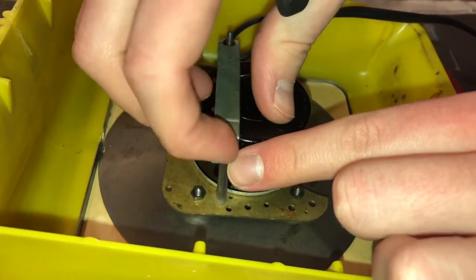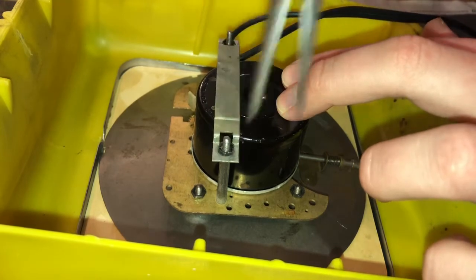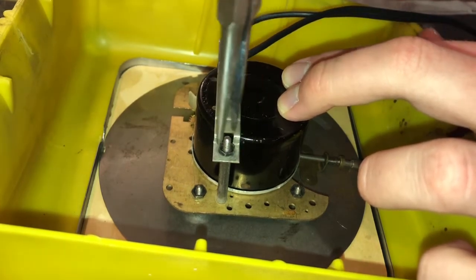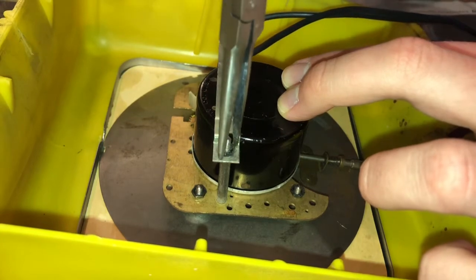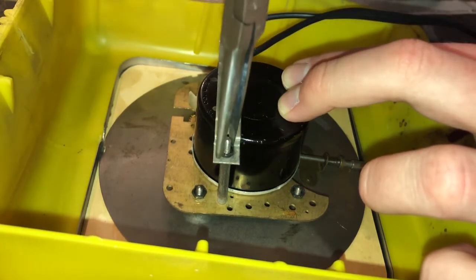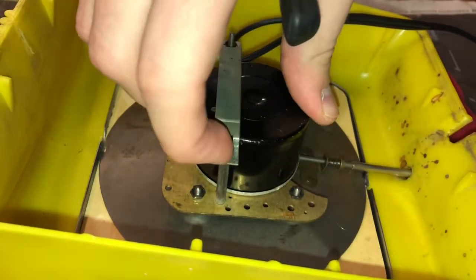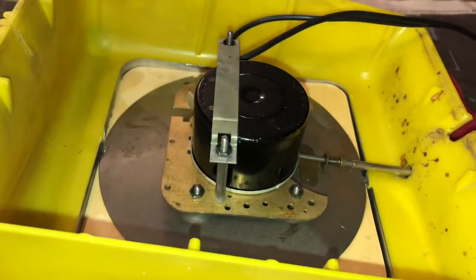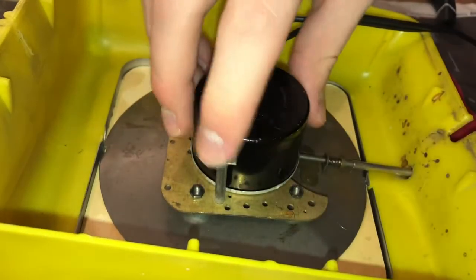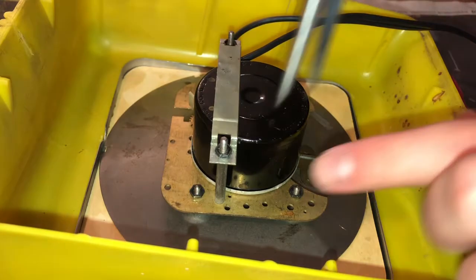Electric clocks, as I said, are just powered by a rotor. The rest of this is just motion work, honestly. That's why they could scale it down a bit, because there's nothing here except for the rotor that actually drives the clock. All the rest of this is just moving the hands around. They did scale mechanical alarm clocks back too, and I would assume other clocks fell victim to this, where they were literally just riveted together and things were being built really poorly. Oh man, I hope you can understand what I'm ranting about, viewers. I don't know if I'm making any sense or not.